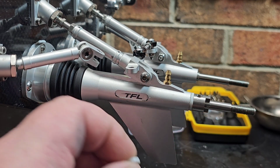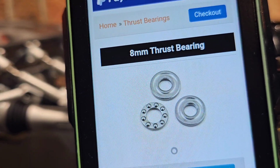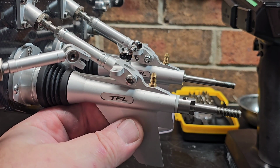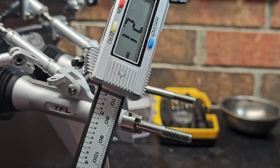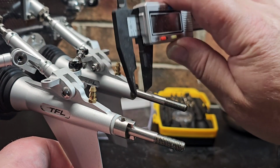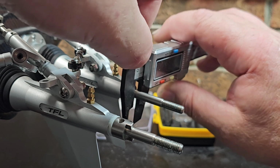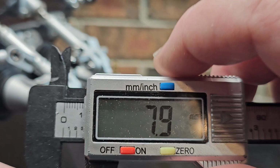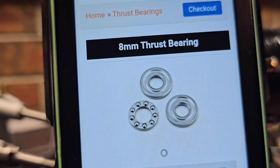It's pretty close. Okay, so earlier I had mentioned getting a 1/4 inch thrust bearing like this. But I was looking here and I noticed it earlier, but it's kind of hard for me to talk and think and explain on the fly. I noticed it, but I didn't really mention it. This main shaft is where that thrust washer's sitting, not on the 1/4 inch shaft. So we're basically going to need to get an 8mm inside diameter thrust washer, right? This guy right here, thrust bearing.